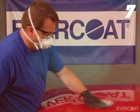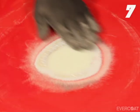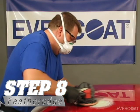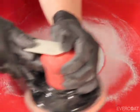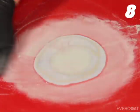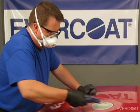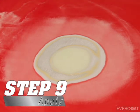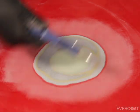After all dust is removed, inspect for low spots and pinholes. Feather edge the perimeter of the repair and into the clear with 180 grit on a DA sander — this will remove the straight line scratches from the block sanding process. Be sure to remove all straight line scratches from the clear coat. Now the repair is ready for the application of Evercoat Premium Putty.